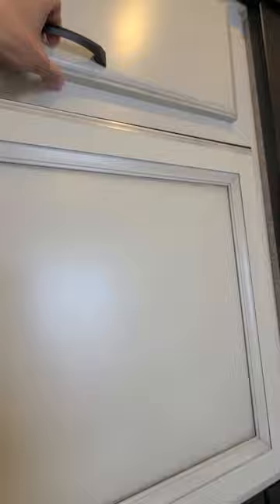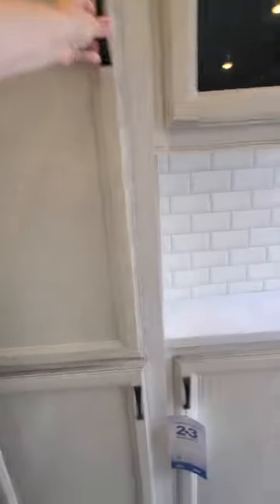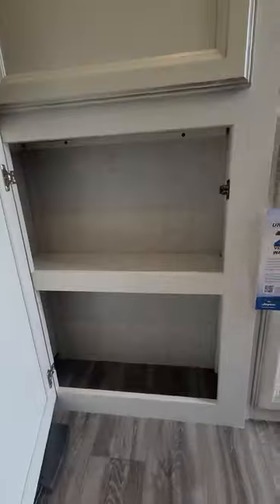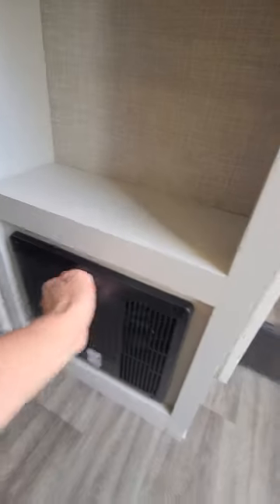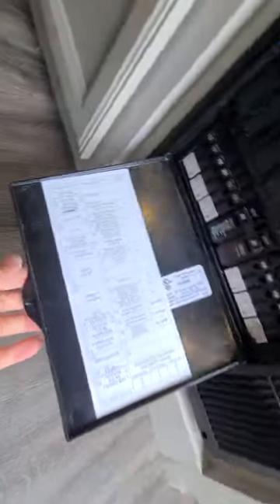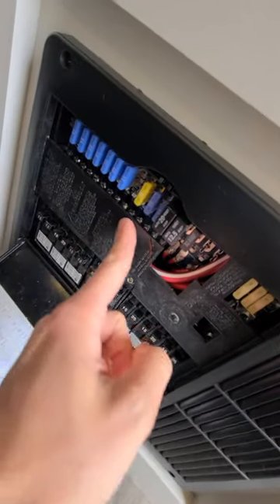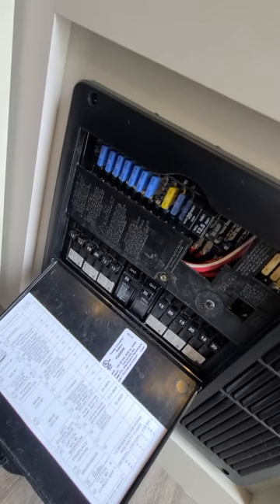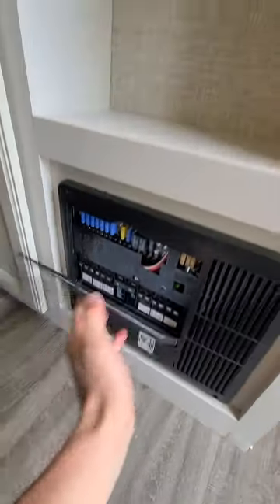You're able to still carry all that nice cool stuff with you without having to wait as long. More storage space above, more pantry space here and down below, and then we've got one more right next to our converter box with all of our breakers and fuses. It's all going to be neatly labeled right here, and one of these will illuminate red if there's something blown. So if you open this and see a red light, you know you're going to have to replace those fuses.